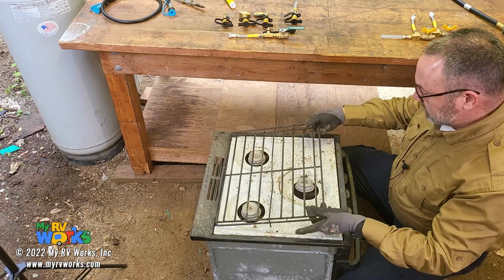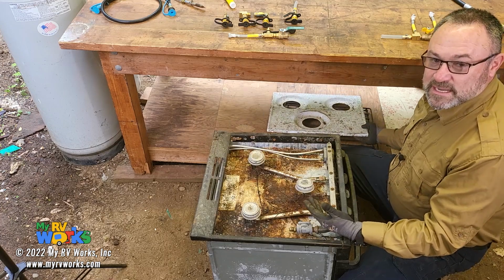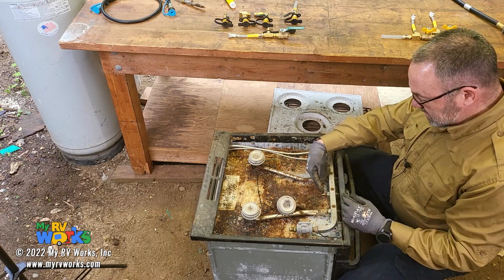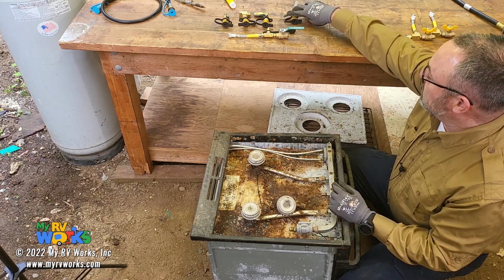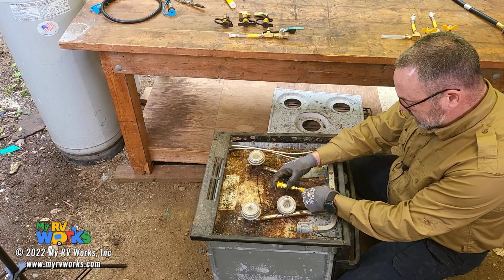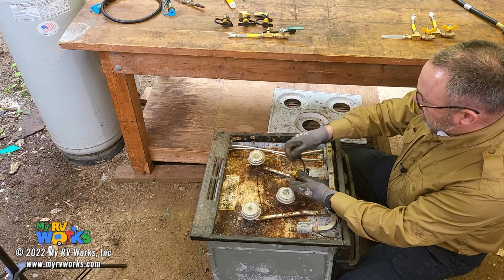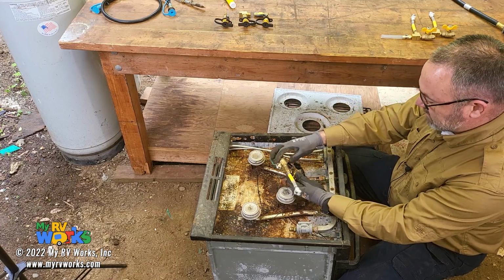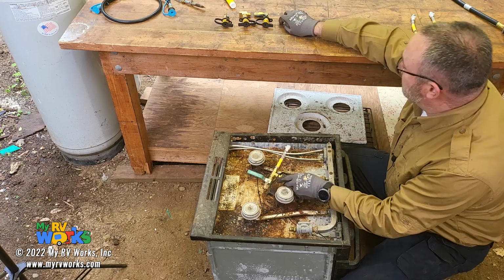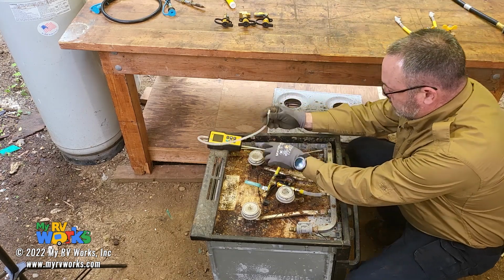Okay. So to do it at the stove, you would lift up your stuff. Now this is obviously an old nasty stove out of an old nasty RV. But basically you're going to move one of your burners and gain access to your little stove bud right here. Then you would take the one with the tube on it, and connect it right onto that bud right there, okay? And then you would take your manometer, your manifold, I'm calling that a manifold, okay? Close everybody, open him up. And then your manometer would then connect right onto there.